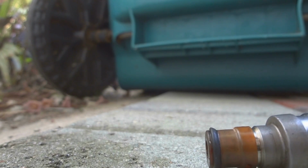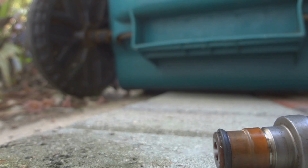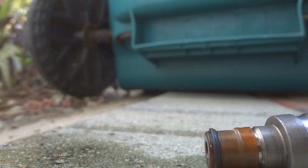Watch. See that? The injector is off, so when I put pressure in there, it shouldn't be spraying out at all. So that means when the car is on, it's constantly spraying gas in the cylinder, which just wastes gas, and it'll weaken the oil, because the oil will become full of gas. So definitely after this, gonna have to change the injector and change the oil.